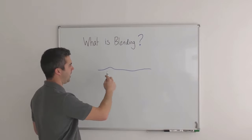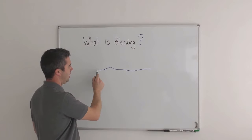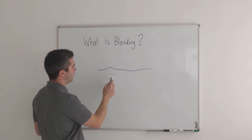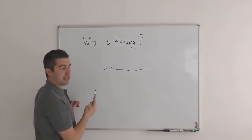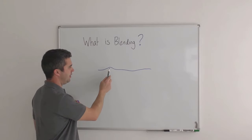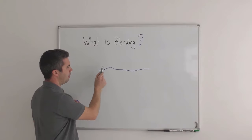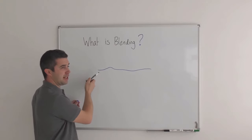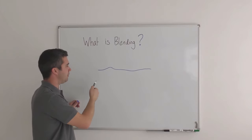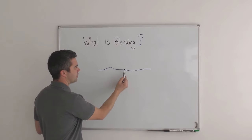On our panel you've got a slight crown or ridge - this should be roughly flat but potentially a low spot down here. It's a bit like with your tap down hammer - you're tapping down this high and it's spreading out the metal either way, but by tapping it with the blending hammer and repeatedly tapping it, getting that nice rhythm and building up energy and momentum in the panel, you're creating those waves that come across.